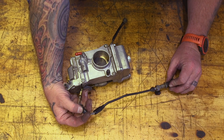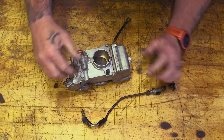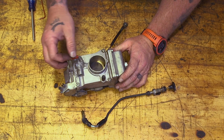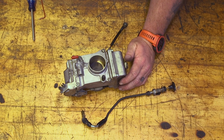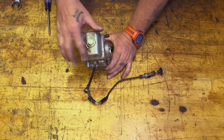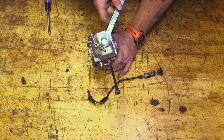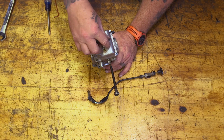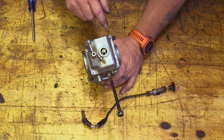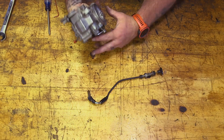As you can see, the choke cable is broken. Basically how the choke works is when you pull on your choke knob, it pulls that little plunger back out of the hole and allows the fuel in this extra circuit to go into the motor, adding a little fuel for a nice, easy cold start. On the bottom of the carb here is the float bowl. It has a handy access point — if you want to change a main jet, you can get to it from the bottom without having to take your float bowl all the way off.